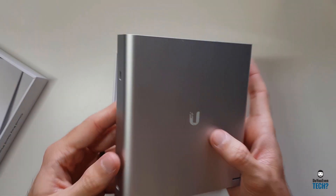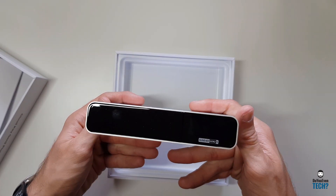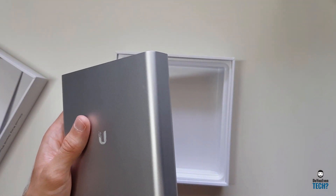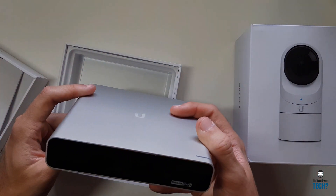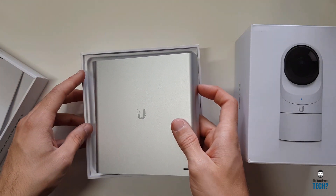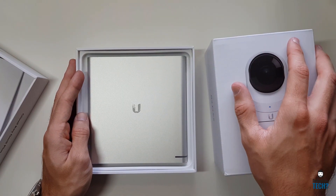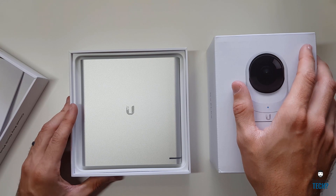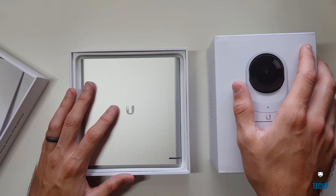I've been waiting for a device like this. I'm going to keep the beta updates on it so it has the latest features and I can check out everything they have to offer. I do have a G3 Flex that I plan on tying in with UniFi Protect so I can adequately test it, and I do have an extra USG that I'm going to attach to it just to ensure that both the SDN side and the UniFi Protect side are working like they should. Hopefully I can help work out some bugs and end up with an awesome system that I can replace my NVR and Cloud Key with — something even less expensive than the NVR itself.